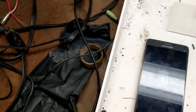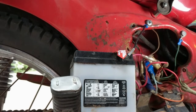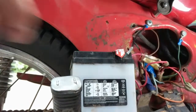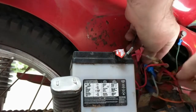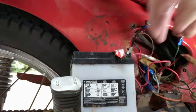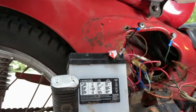I have confirmed using a multimeter that this red wire becomes hot when the ignition is turned on. So I'm going to remove that and use this little splitter to reconnect it, and I'll put this module in a little battery box — it actually works quite well. I'm going to tape it up.